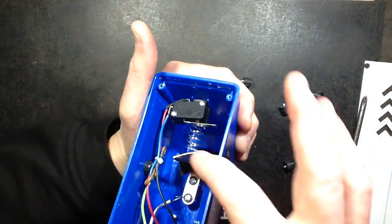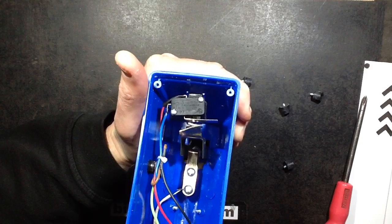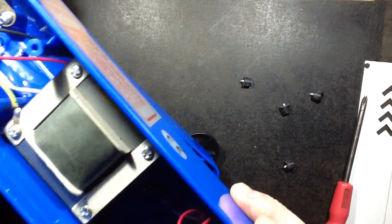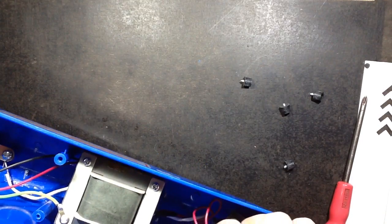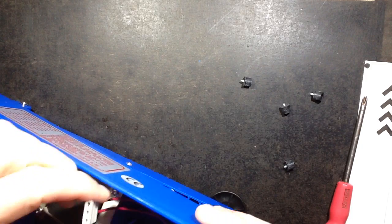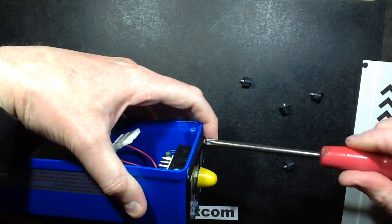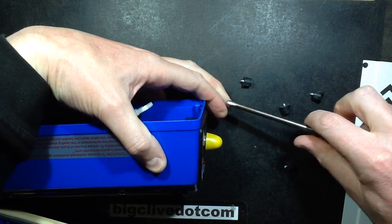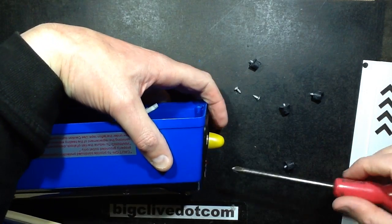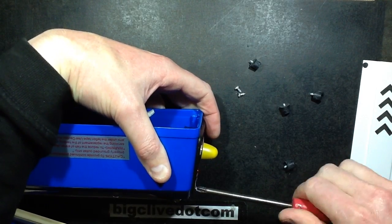The neutral is switched through the switch, goes back through the red to the power supply, and then the two reds just go to the transformer. The transformer's output is tacked onto this bit of metal and then the terminal at the other end of the heating element. This spring lifts the handle up, and all that happens when you close the handle down is it hits that switch. As long as you hold it down it runs the unit, but the unit then cuts off on a relay.